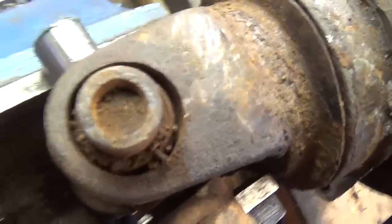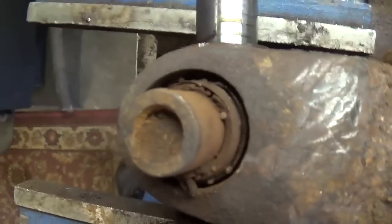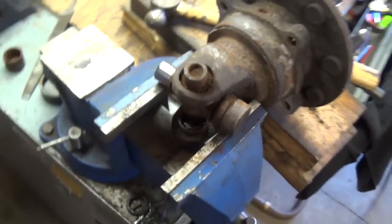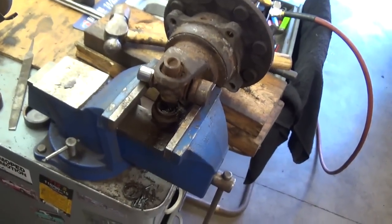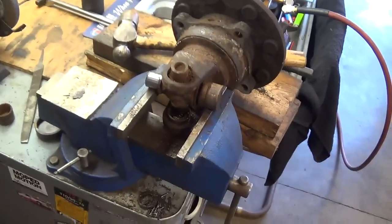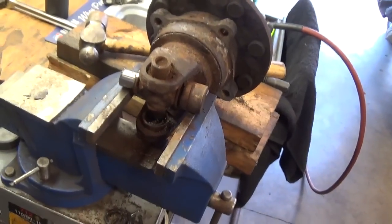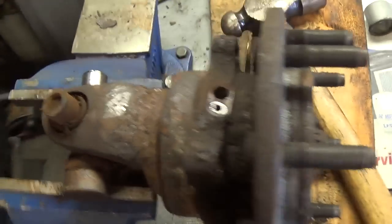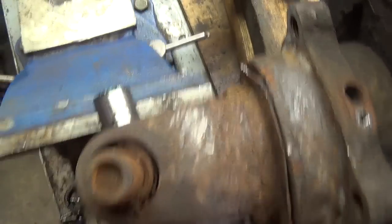Two of them are good, that one's all right. Just that one cup. I'm using the Thor method from Brian's Mobile One — I'll put a link in the description — it actually works really well. You see, I haven't even taken the axle out or anything, just bang right there and it'll pop right out on your vice. And there's the rest of the axle.